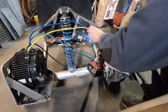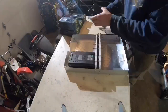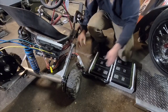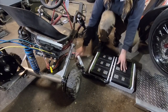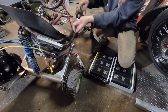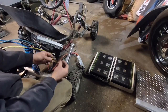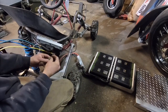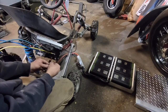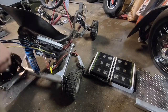Let's hook up the phase wires to the speed control. If we put the positive and negative cables to the speed control and put all our batteries in the battery box, technically we can see if the motor actually works. I also wired up the foot throttle, so all that's left is — I don't have the key yet, so I'm going to use this little jumper wire as a key. Let's turn it on and see what happens. So far it's all good.